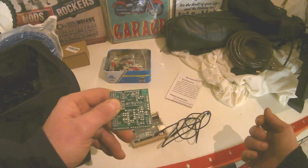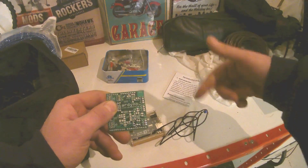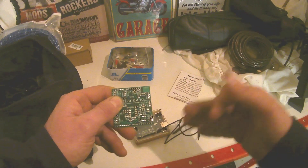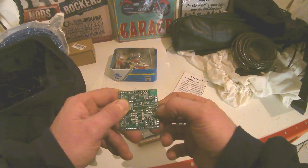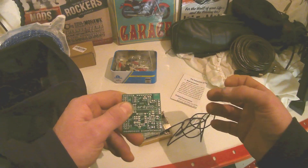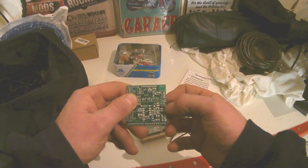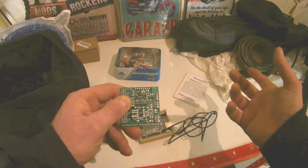Cap RPM is your spark signal - you attach a little clamp like one of these on the earth for the bike, and the signal wire goes straight to your spark plug. You wrap a copper wire around it, and it picks up the spark signal and calculates that into RPM on your dyno. Hall RPM is an RPM sensor that's already on your bike - if your bike has a cam sensor, digital crank sensor, or it's an injection bike, it will run a Hall RPM so you can piggyback off that.